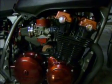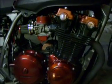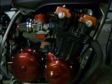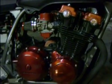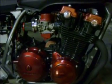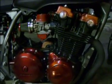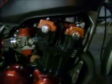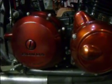Did some painting on the engine. It ran when I got it but a little rough — had to adjust the timing and ignition a little bit, readjust and reset the carbs. All the red on the bike is actually just spray paint — it's Dupli-Color Metal Cast Red. Creates an anodized look over bare metal. If you sandblast the metal first and then paint over it, it gives it a matte finish look. The valve cover was done sandblasted and then painted, and the engine casing covers were all just polished up and then painted over with Metal Cast.